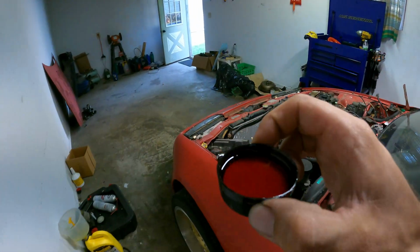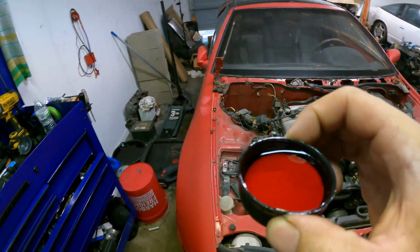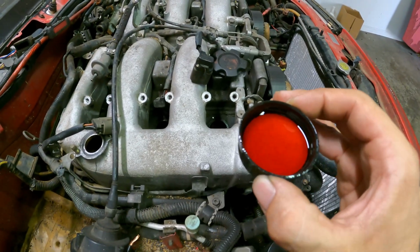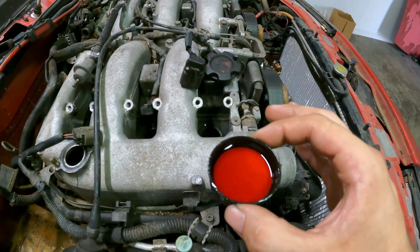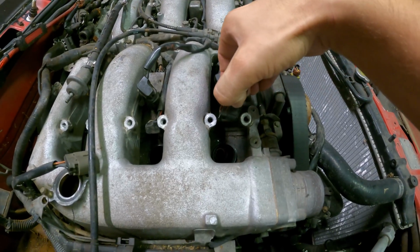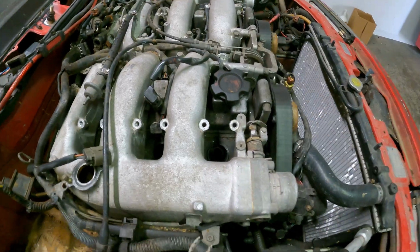I've heard to use about a full cap worth of fluid. I did pull about 5 milliliters out of this and it was very insignificant. But the biggest thing is you don't want to put more fluid than your combustion chamber actually combusts, because then you'll hydrolock your motor. Well, you might bend the rod, not necessarily hydrolock. Dump that right down the spark plug tube guide as that all seeps down into the cylinder. Let's go grab our compression tester.